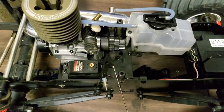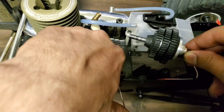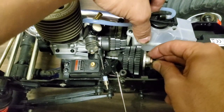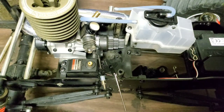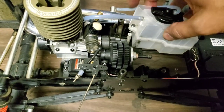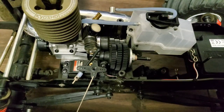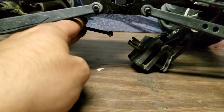Here's our three-speed transmission ready to be installed. Making sure the bearings are still in there — yes, they're good. Going to slide that in. Might need to move the fuel tank slightly to get enough play. There we go — got that in. Let's get the fuel tank back on. Now we've got it suspended, and we need to get the diff assembly back up and get the sprocket through. The diff linkages obviously came off so it's very easy to slide those back in — there's one on each side.